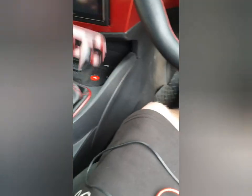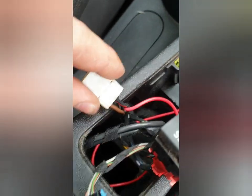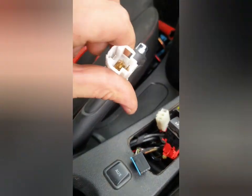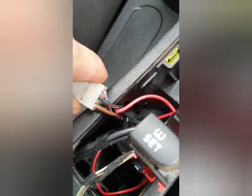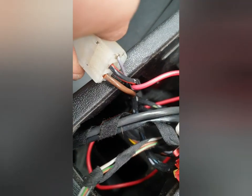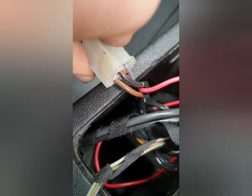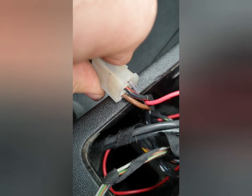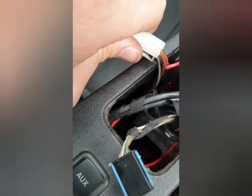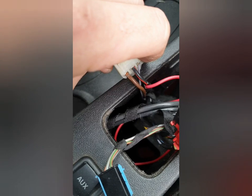That's all on there now — zoomed in, my bad. Put the lock nut on there with some tape. So you go to your three-pin switch plug on your actual original cigarette lighter, which is here. It's got three pins — I can see straight away I've got an ignition live feed coming off there. The black and red is ignition live, the brown is earth, and the other one I'm not quite sure what that's for. So I'm going to cut it off, tape it up and put it to the side. I'm just going to use those two, then cut it down and put some spade terminal connectors on there.